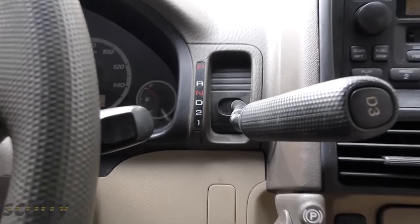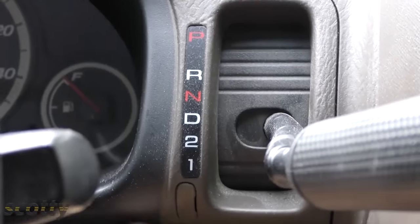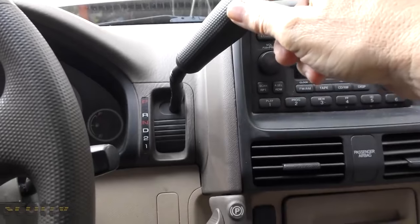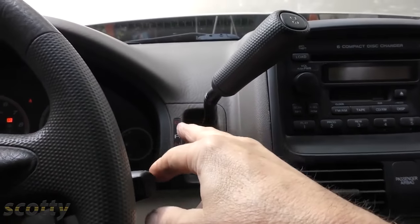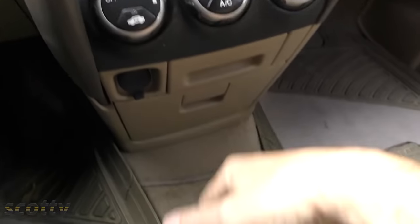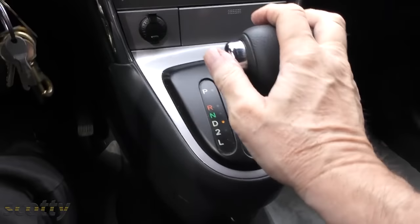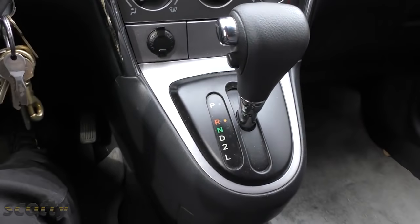Never accidentally shift from drive into reverse while the car is still moving. The Honda has a dash-mounted shifter which makes this harder to do accidentally, but many cars have the shifter on the floor where it's easy to accidentally knock. If yours is like that, make sure you don't accidentally rip it into reverse while driving down the road - it will destroy the transmission. I've had more than one customer whose teenage kids, while learning to drive and goofing around with friends, did exactly that. They hit reverse, destroyed the transmission, and on older cars the car ended up being junked.